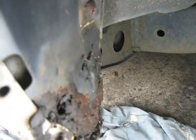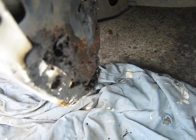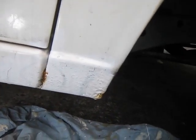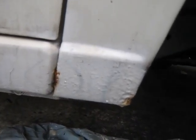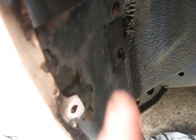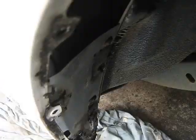I've removed these fasteners and was able to bend the mudguard back up and under. That exposes this plate here covering the inside of the panel. Coming down here, you can see quite a bit of rust and a lot of dirt build-up there, and that is the cause of the rust reoccurring on the lower part of the panel.